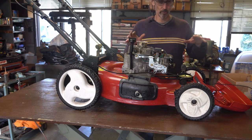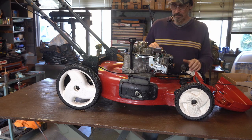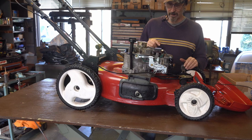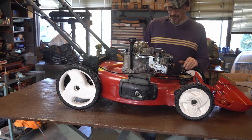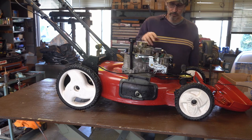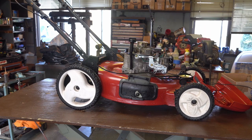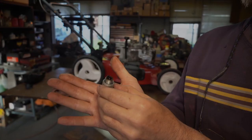Let's get it apart. I'm gonna start doing my thing to it — liberate this, throw out the junk, pull the carburetor, do a compression test, check for spark, and I don't think I've gone into this carburetor yet, so we'll do all of that and be back in a bit.